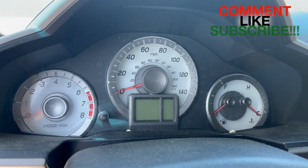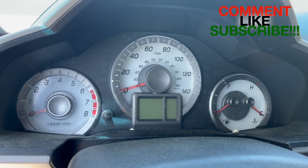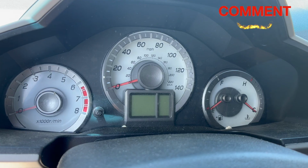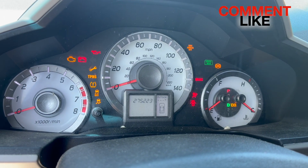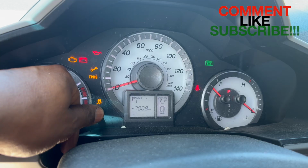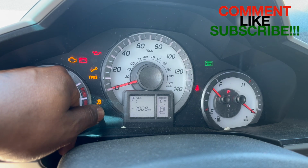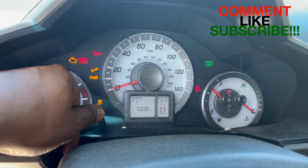Okay, guys, this is us resetting the oil life. After you're done with your oil change, you want to make sure you reset your oil life. You take your key, put it in the ignition, 2 clicks. You're going to see all the lights come up. You're going to go to the trip odometer button, okay? And you're going to click through till you get to the oil, right? And we were already at the oil. It's the oil right here. You're going to press and hold.